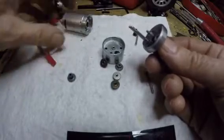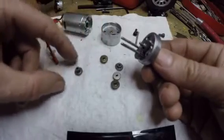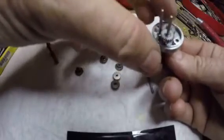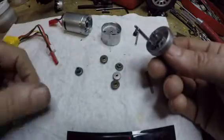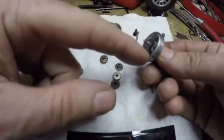This is actually a 56 RPM motor, so this shaft turns 56 RPM. I think these gears — I tried measuring them and I didn't count the teeth — but I think they're about 3.3 to 1. So any of you math majors out there want to figure this out for me, leave a comment. I don't know what size the final drive is — it's bigger than the rest of them — so I didn't even factor that in, and I didn't really figure out what the total reduction is.